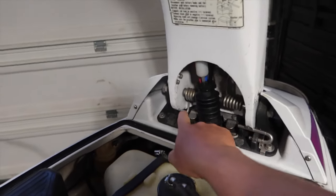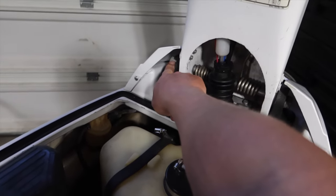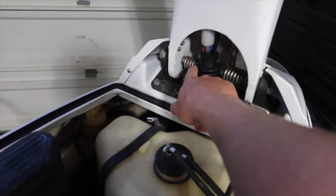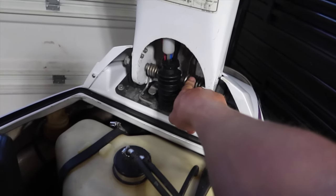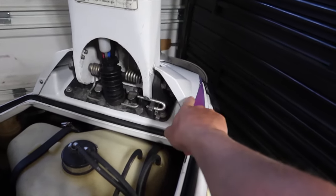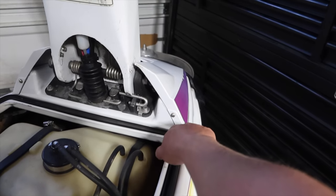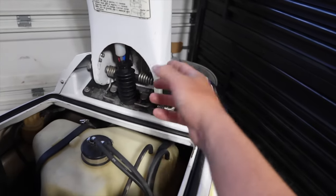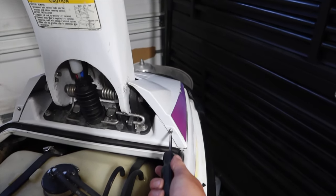So that's the problem I'm having, so let's fix it. Our main goal is to go ahead and take these bolts out. There's a giant bolt with two locking nuts on this side that runs all the way through to this side, so we gotta get that bolt out to get the springs off and change it out. We can't take it out without the cowl off, so we're gonna take this beauty nose cone piece off - two Phillips screws and it should pop right out.